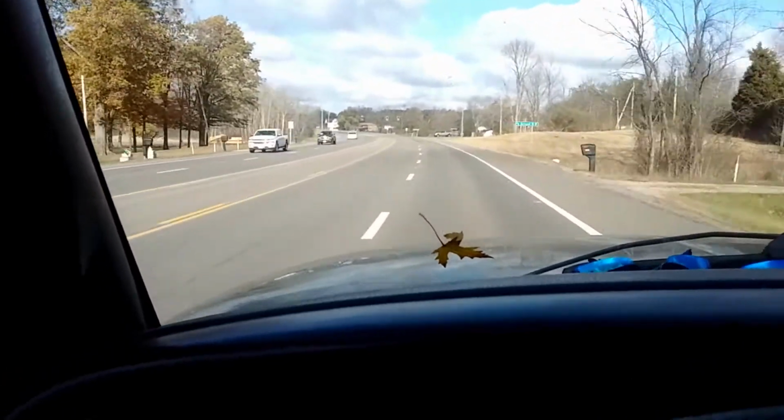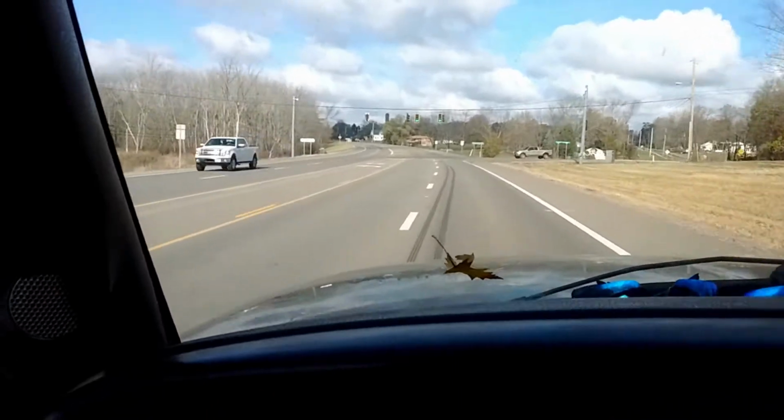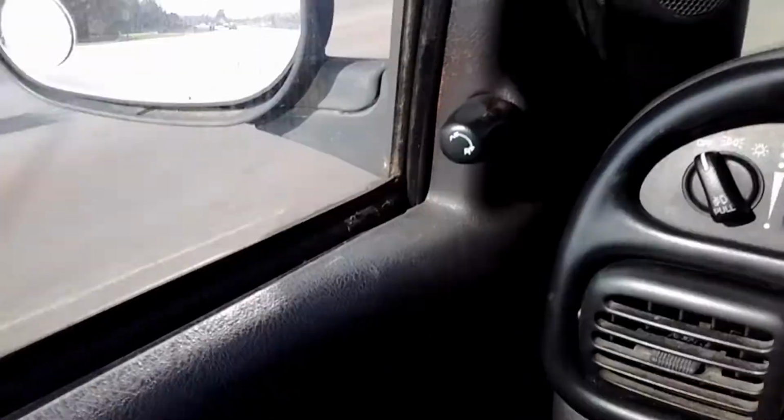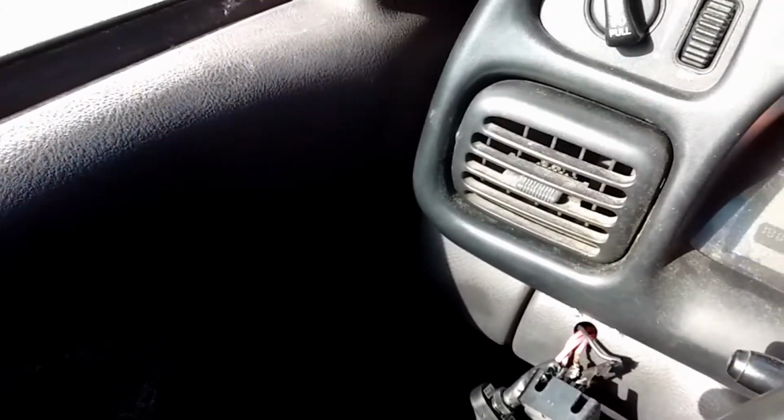So here's inside the door. That's kind of what it looks like. Some of it will creep out, which it should. Then you just take a knife and cut that flush. Then put your door panels on and you're ready to go. And that provides a lot more insulation if you have rusty doors.